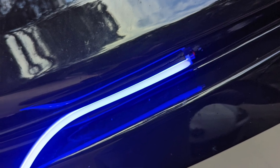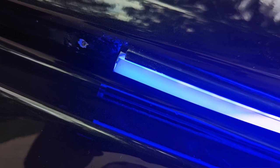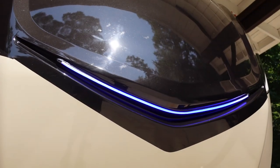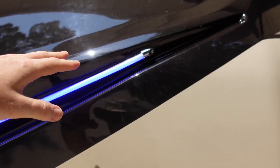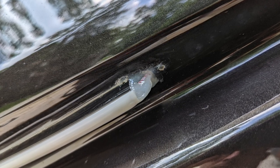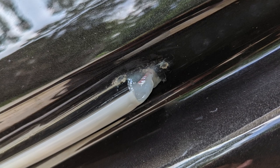You can see I've carefully stuffed the excess wires back into the hole in the front cap and then started snapping the vinyl tube into the existing black track. Everything looks good — the blue LED inside is nice and even across the entire length of the tube. But we don't want to stop here. We need to seal it up, and this is where I failed in my first replacement attempt. I used GE Silicone 2, the clear stuff. I carefully sealed both ends of the vinyl tube, making sure it went into the tube a good half inch or so, then let it bulge outward a bit especially on the wire side, to fully capture those wires so no water can get into the tube.